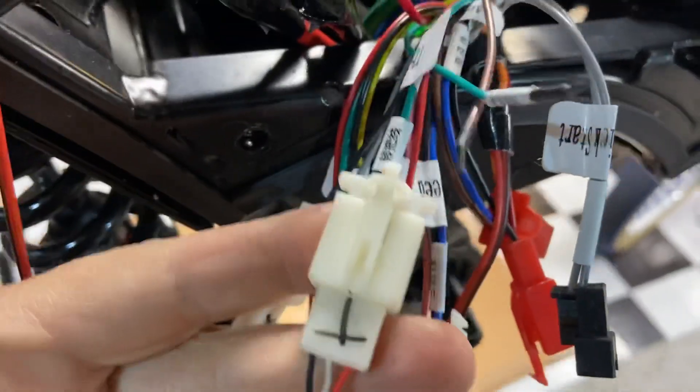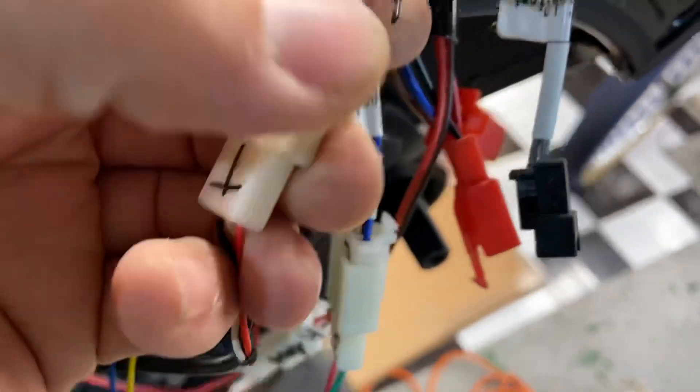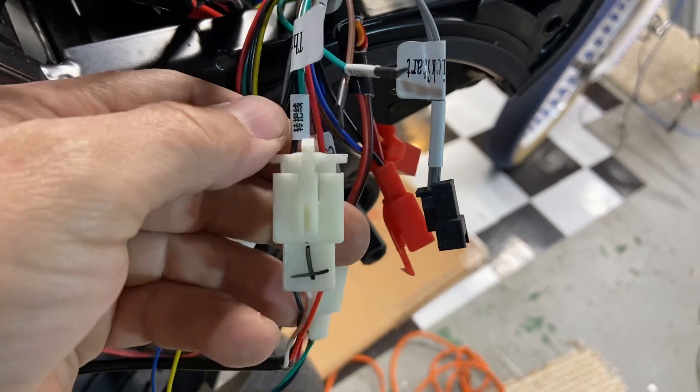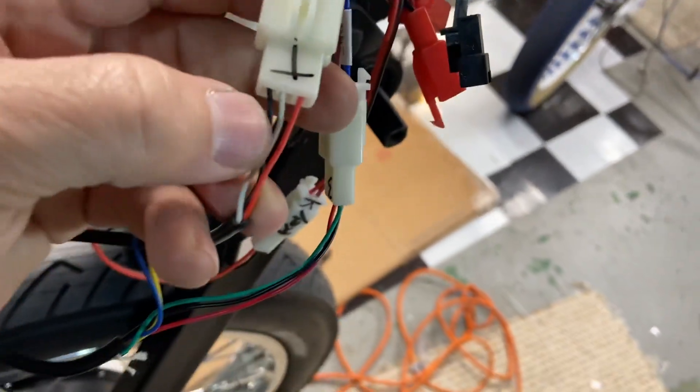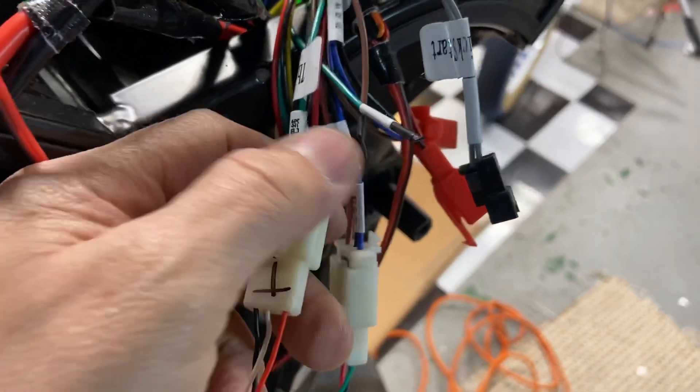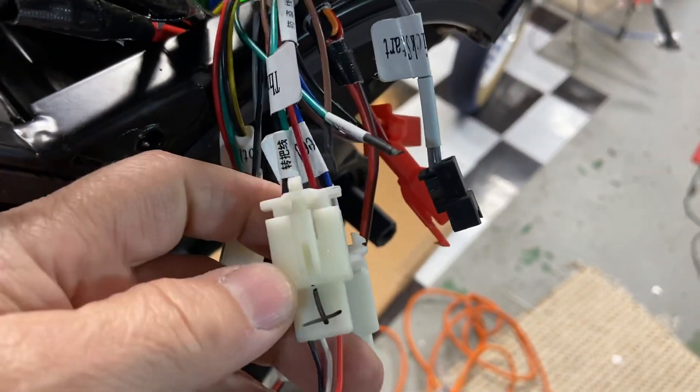Your throttle is three wires. I put a T-connector on mine. I usually put my red wire where the groove is, but your wires have to match — your red and your black. The throttle signal wire is white, but it could be any color. The only important thing is that your throttle thin red and thin black match up.